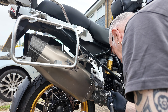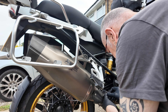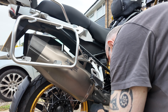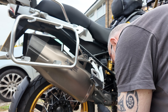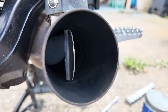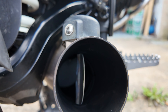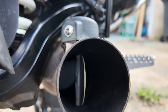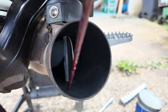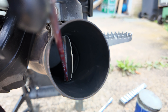So I have a slightly different plan of attack for today. I also want to see if the flap is circulating like it should do. And then lube it in a slightly different way with some copper grease. The exhaust is clearly off and you can see down into the exhaust itself. What I'm going to do is get my paint brush and paint some copper slip around the bottom, so it hopefully dribbles down into the affected area.